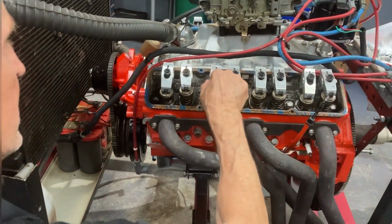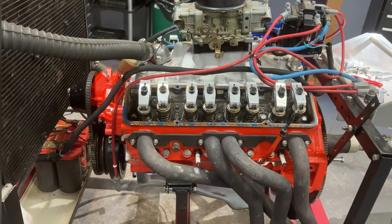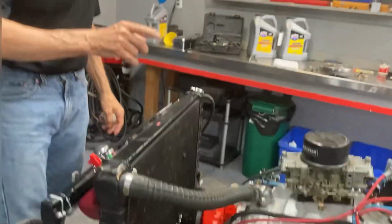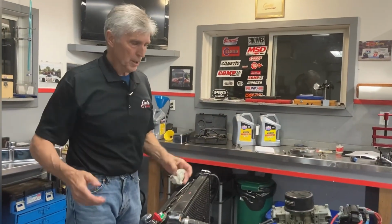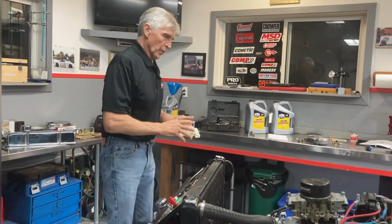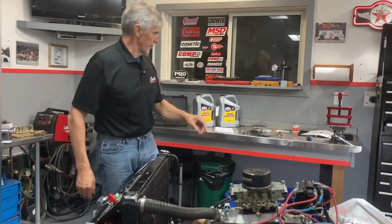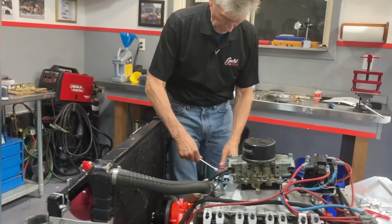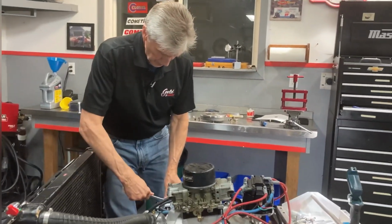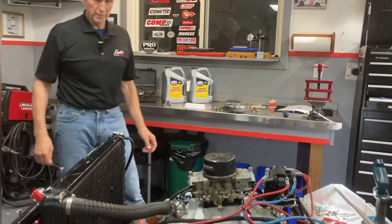3 is there. There, we just checked all the valves. They're all done. That's how easy it is. If you're readjusting your valves, do not unscrew them and do it all again, because you're just likely to cause a problem. One of the things I do every time we take the valve covers off is take a 5/8 wrench and, once we've done all that, just go over and make sure they're all nice and snug. And I'll save you time watching all that.